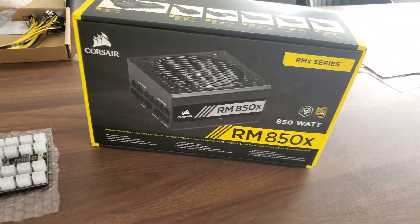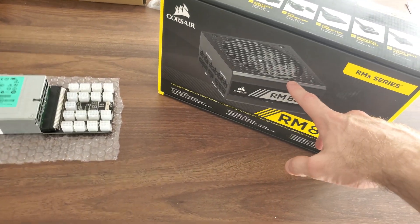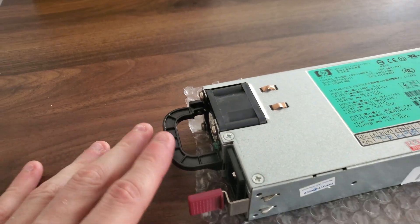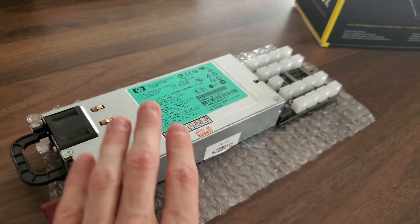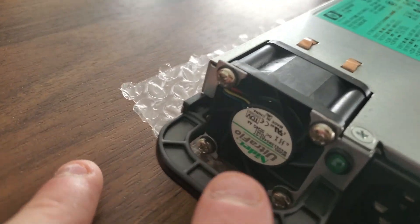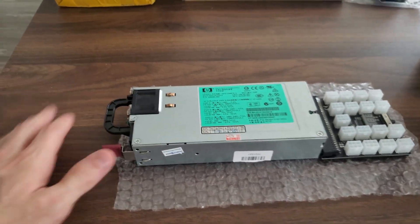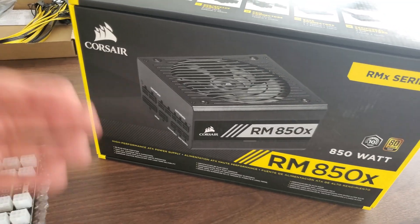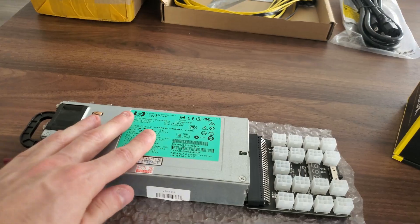The two other categories are noise and heat. In terms of noise, the ATX power supply is the clear winner — look at the size of the fan here versus that tiny puny fan on the server PSU. Obviously the server PSU makes a lot more noise; I wouldn't want this running in my bedroom. It's not too bad at low load, but once it gets cranking up to higher wattage and the fan gets spinning fast, it does make quite some noise. In terms of heat, this guy gets hot no matter what — even on low load as soon as it's on it gets pretty hot. The ATX stays cool under low load, though it does get hot too around 700 watts — just not as hot as the server PSU.